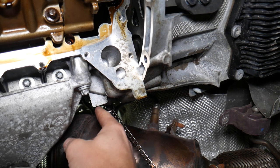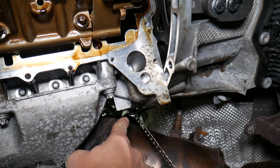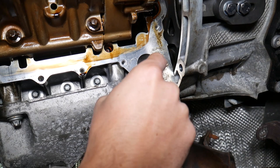Some people remove the bolt with the TDC pin in, some with the TDC pin out. If you leave the pin in and that tool develops a little bit of play, all that tension will transfer to the TDC pin and you can break your engine block or bend your flywheel — you don't want that to happen.